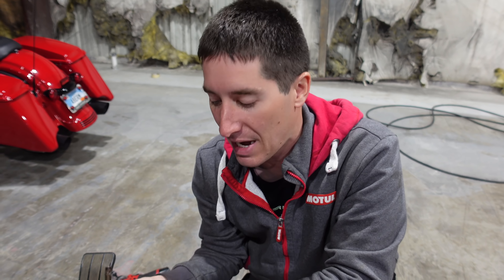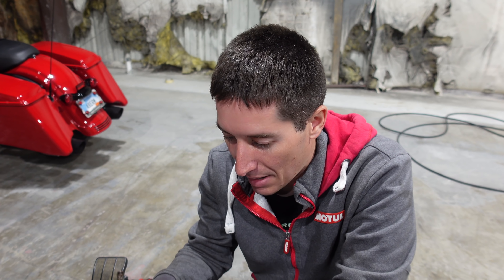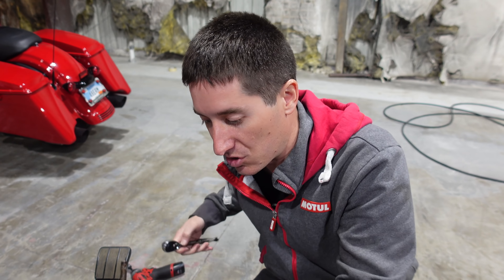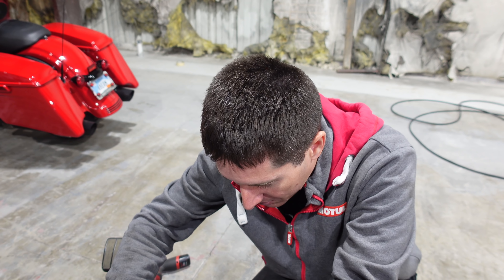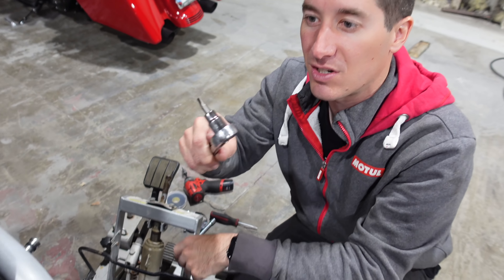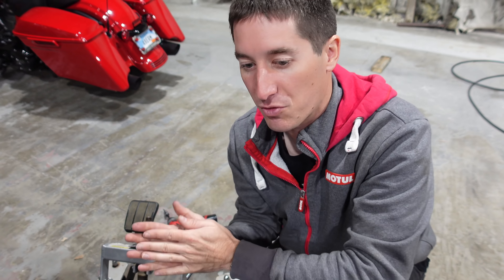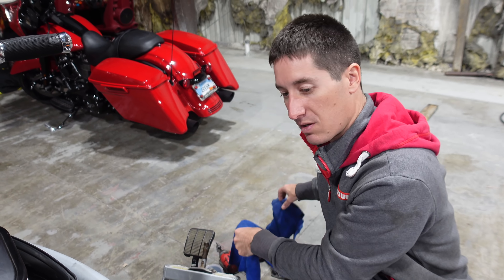I went ahead and backed the screw all the way out - the screw has a little o-ring on it. There's no bleeder. This should really have a bleeder - I think the later model V-Rods got one. This literally has a screw. So I backed the screw all the way out and then had Durrell slowly squeeze the clutch lever and hold it, and it blew all the fluid out like we would expect. Then I just shoved the screw back in as fast as I could and tightened it down. I'm hoping that's our bleed method for not having a bleed screw. The best thing I found to get in there was a little flathead on a socket, and I also covered everything with rags to protect it. So let's see if we've got a clutch now.